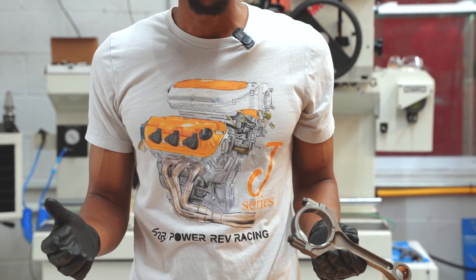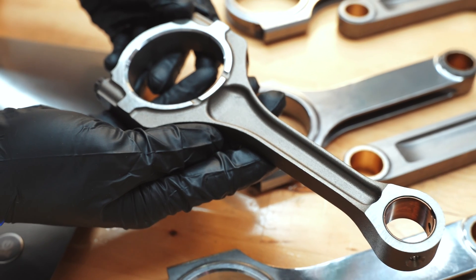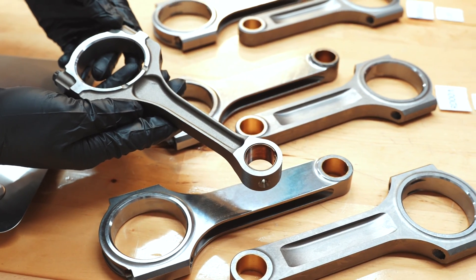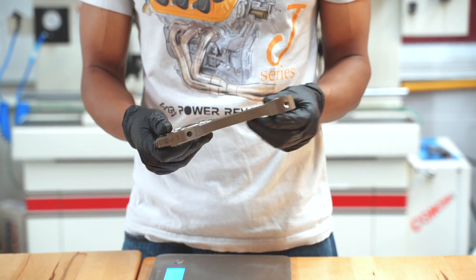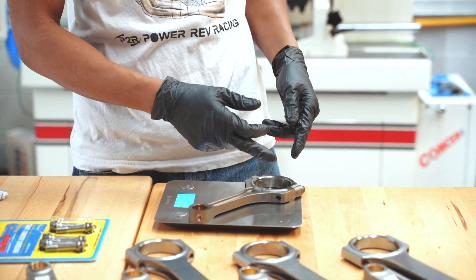When it comes to balancing a V engine, the most important part is that you have to add or subtract weight on a crankshaft. In the case of the J-Series, you're almost always going to be adding weight to your crank. The factory rod is literally pencil thin — this is a factory J35 rod. You can look at that next to our connecting rod and see the difference. These things don't hold any sort of horsepower; they're always bending and breaking on guys once you start crossing that 400 horsepower mark. And being pencil thin, if we go ahead and weigh this stock connecting rod, it's only 523 grams with the bolts in it. So we're going to be heavier on all of our connecting rods compared to the stock rod, but obviously our rods are going to hold a lot more abuse and a lot more horsepower. I've even seen the stock rods snap in a high compression naturally aspirated setup — they just don't work that well.